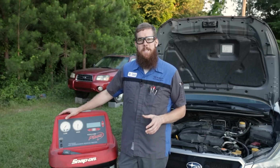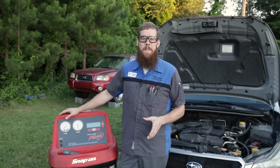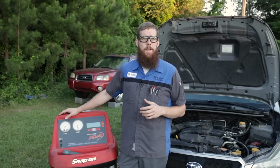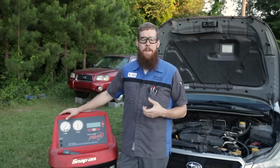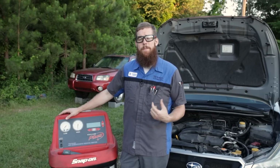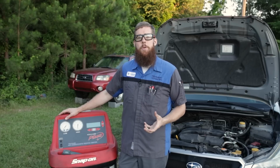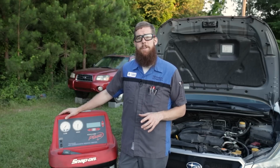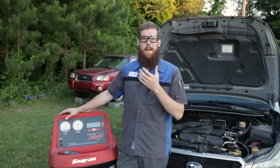So before we get into too much about AC systems, I want to stress first a precaution. Air conditioning systems can be extremely dangerous to your health to work on. These systems are under pressure, very high pressure. You can have explosion, very unlikely. You have to be very careful working around any refrigerant actually. You can have frostbite, burns on your skin. If refrigerant touches you, it can blind you if it sprays you in your eyes.